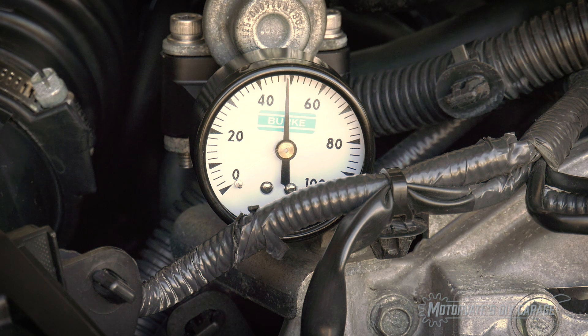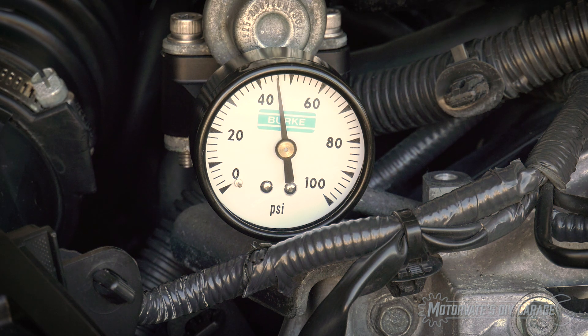We have just turned off the engine and we can see our fuel pressure is about 48-49 psi. We're going to come back in 30 minutes and have a look. According to Nissan, the fuel pressure should not drop below 30 psi in 30 minutes. If it does, that means we have a problem with our fuel pressure regulator in the gas tank, or maybe a leaky injector or some other fuel system issue. In this case, my fuel pressure was above 48-49 psi and it's now dropped down to 46 psi after 30 minutes. That tells us our fuel pressure regulator in the tank is good, and we don't have any fuel injectors that are leaking. With all that being said, our fuel system has good integrity.